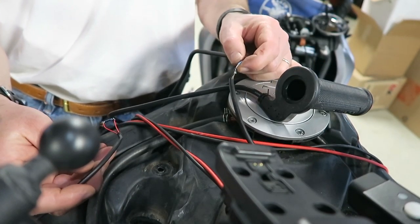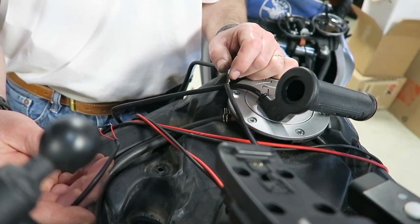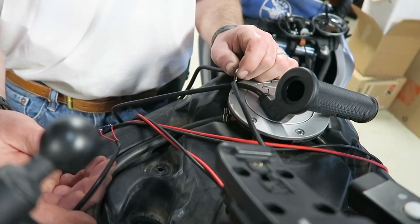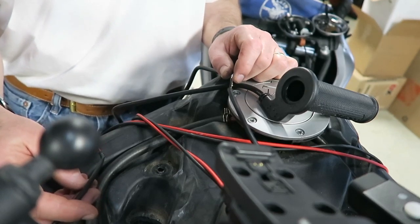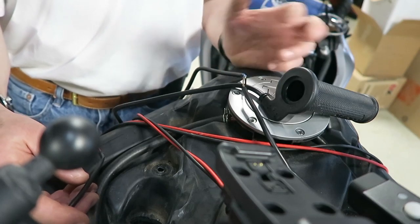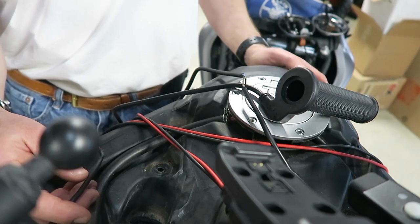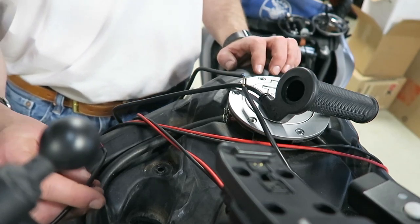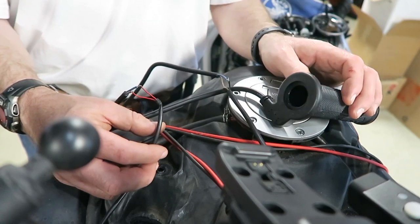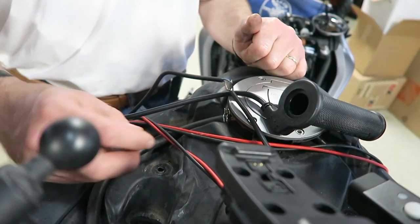Now you can kind of ignore everything on the web about putting on new Multistrada hand grips for $400. And I guess I just don't call those guys anymore, but the dealer wants something like $250 to put them on, which is again ridiculous, because you do have to take everything off to get underneath the gas tank to get to the place where they're connected. But if you do this, you just cut the connectors, solder in new grips, clean it all up, and it'll probably work for the lifetime of this bike error free.